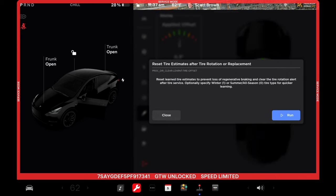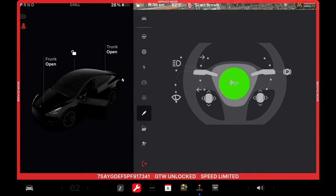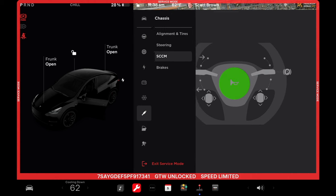Below alignment data you have the tire reset — this resets the tire wear estimates. Whenever you do a rotation, you go in here and set that up, and whenever you change tires — for example changing from winter to summer — you can do a relearn. We also have a steering panel for the steering wheel control module; you can check all your different buttons. Pressing on the left wheel, right wheel, and park button lets you see all those inputs, giving you some diagnostic panels you can use.